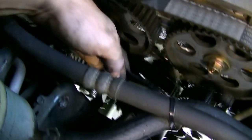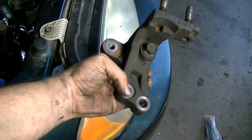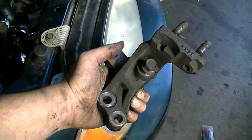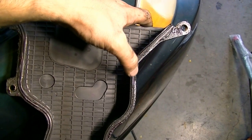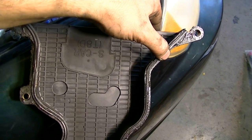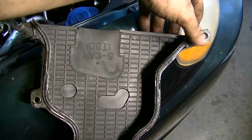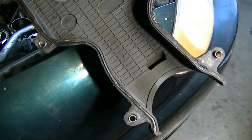Here's our motor mount bracket and here's our lower timing belt cover. The motor mount bracket has three 17 millimeter bolts and one 14 millimeter bolt for the alternator bracket. The lower timing belt cover comes with a rubber seal around its circumference - make sure you don't lose that. If it's dirty, clean it up; if it's broken, replace it, because it keeps dirt and debris off your timing belt. If it's missing it will also create an annoying buzzing noise that will be very difficult to diagnose later.